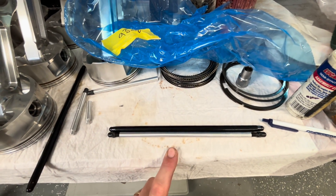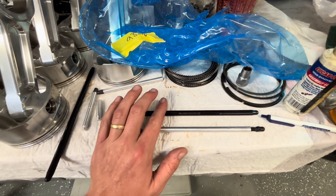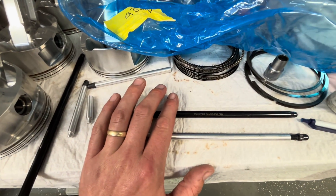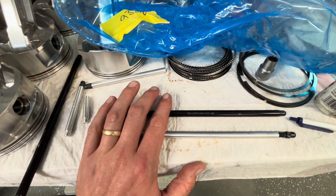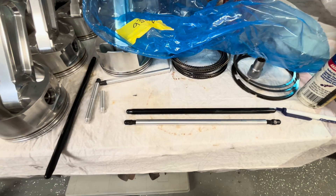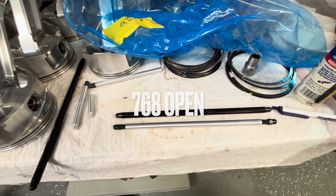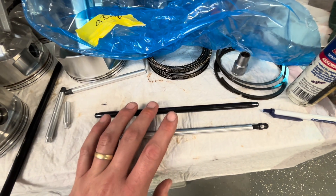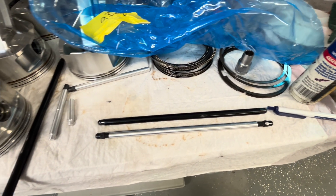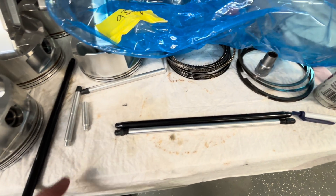He was right on the money. I think when he measured for the exhausts, this is a comp 9-650. It was only 80 thousandth wall. And I think he's got something like 700 or 800 pounds of pressure on these springs. So we want more than 80 thousandth wall — that's kind of the consensus out there.